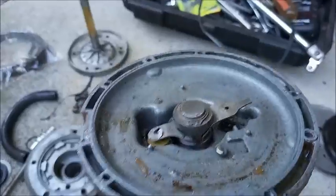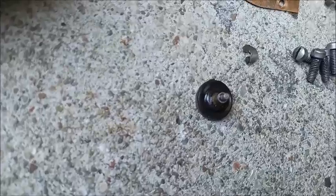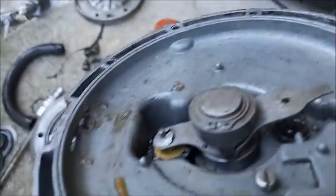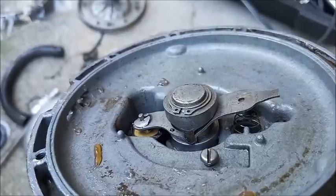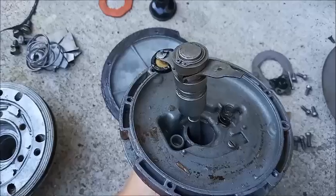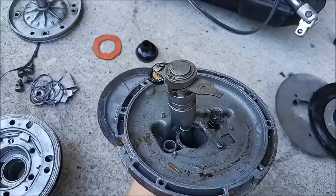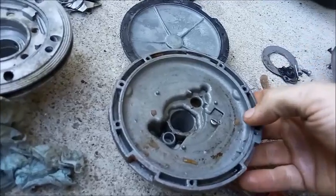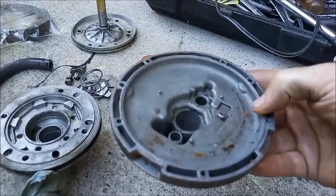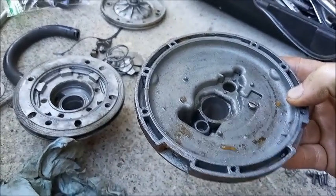To remove this mechanism, we have to remove these two little clips. After removing the one from the atmospheric poppet, it comes out. And notice there's a spring under there. And I think this whole thing can come out, even though the vacuum poppet's still attached. And I don't really see any reason to detach the vacuum poppet. So that's the base of the Bendix piston. Put the J-spring screw back in there just so I wouldn't lose it or get confused by it.